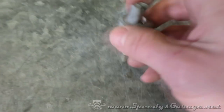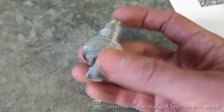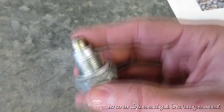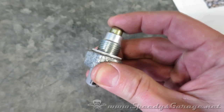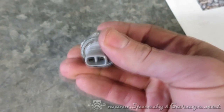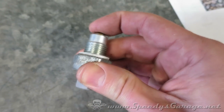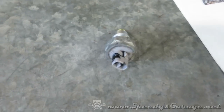What you want to do — you can see how this little solenoid, they call it a switch or a sensor, but I think it's really just a switch — when it's energized that will pull back. You want to have continuity between those two pins when the little check ball there is depressed.